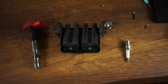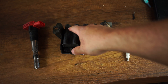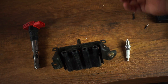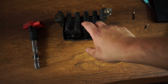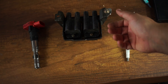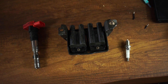The next stage, which a lot of cars in the 90s started to use, is a wasted spark setup. In this example we have a Miata coil pack which uses two coils with four outputs for the four cylinders. Connected to here are four spark plug wires, and each pair fires at once — these two fire, then these two. Two cylinders fire the spark simultaneously; because only one cylinder has fuel in it and the other is on a different stroke, the other spark that also fires is the wasted spark — that's why it's called wasted spark.